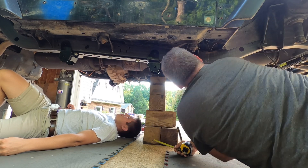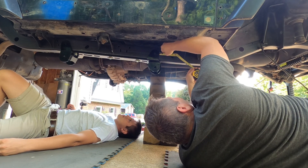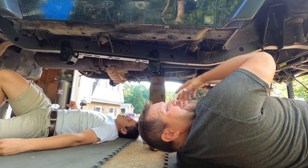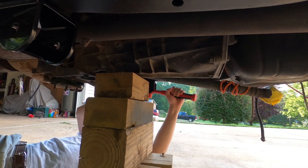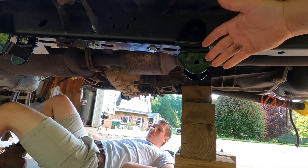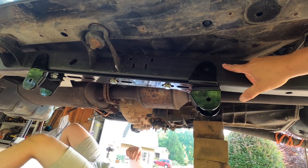Let me take my measurement and see how close we are. Wow, we are right on — I can't believe we're that close. We're within probably a 32nd of an inch, so I think we're good to go. What Harley's doing is tapping those brackets to make sure they've popped up and are not being held down on the frame. Now on the passenger side of this 06 TJ, we have a VIN number right there. Lucky for us, it matches — just so you know, you have a VIN right there.